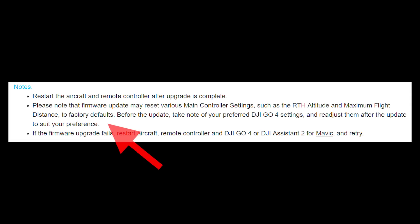One thing to know before you do the upgrade: it does reset a lot of your settings back to default. So if you're not sure what your settings are, go through and jot down some notes, maybe take some screenshots of different screens, then do your firmware upgrade. After you upgrade and before your first flight, go back and reset your settings. It'll save you hassle and battery time in the air.